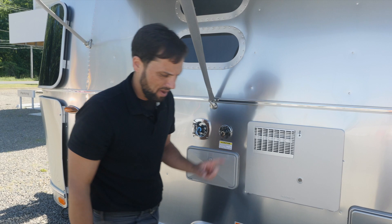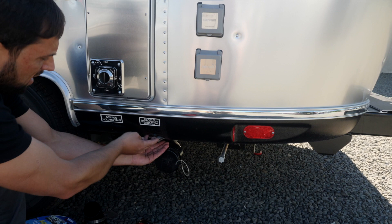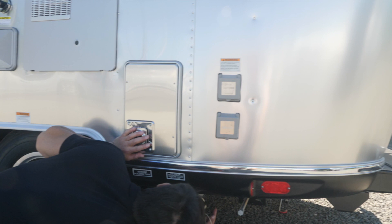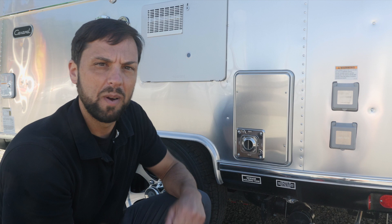There's an LED light to illuminate this area at night. There are specific jack locations on the trailer — if you get a flat tire, use the bottle jack from your tow vehicle at the marked jack points; there's a metal plate at each back corner. Make sure you have a compatible lug wrench to remove the trailer tire. The trailer comes standard with a spare tire. The 12,000 BTU furnace exhaust is here — don't park next to combustibles and caution kids when the furnace is on.